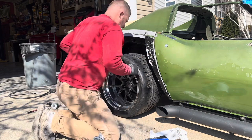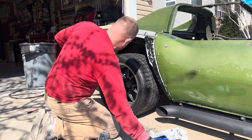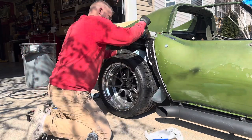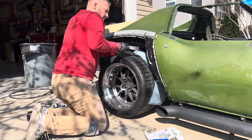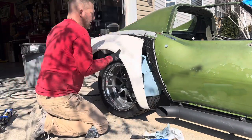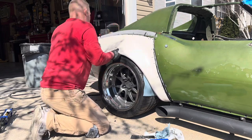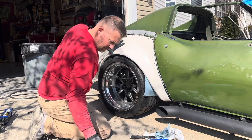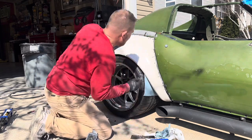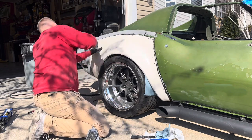The whole time I'm applying the panel bond I'm trying to keep in mind the contact patch. You really need to look at the back of the fender because the contour on these flares starts immediately off of that door jam panel bond area. So you're making sure: A — that the area that's going to contact is solid and there are no voids in the material, and B — when everything's said and done, pull the wheel off and inspect those contact areas. I'll probably end up backfilling, because that area on the original fender had probably an inch and a half to two inches of panel bond backfilling. You're going to go through a lot of material as far as panel bond is concerned.